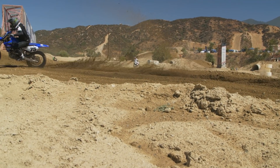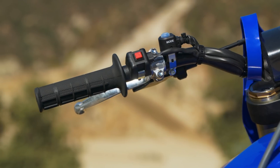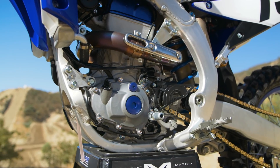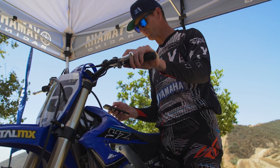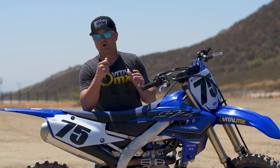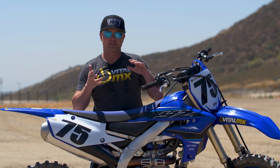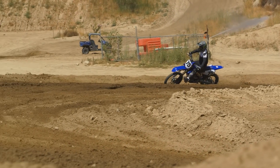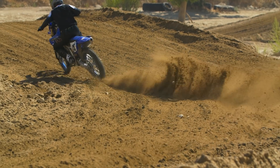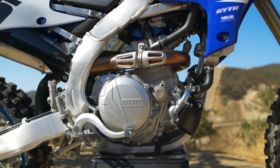Another thing is the maps. This bike comes loaded with two maps, and you can get a Yamaha Power Tuner and change those into any number of maps you'd like. We ran through some today — the stock map and the one we landed on last year called the TP3, named after Travis Preston who developed it. The TP3 is much more aggressive, a much more responsive, racy setup. Stock went a little more conservative, but today at Glen Helen the lines were blown out, hard slick base underneath, and even the stock map was stepping out on me just a little too much at times.